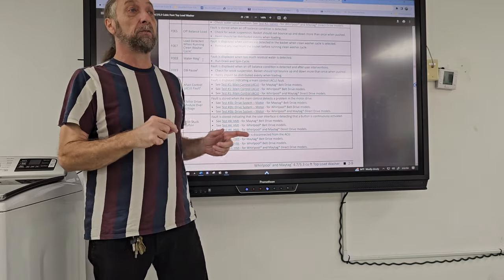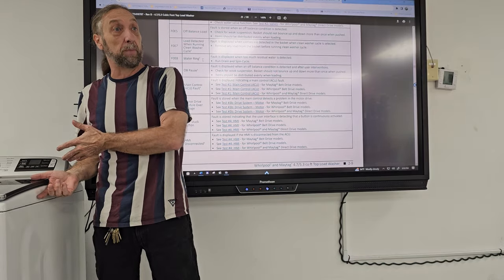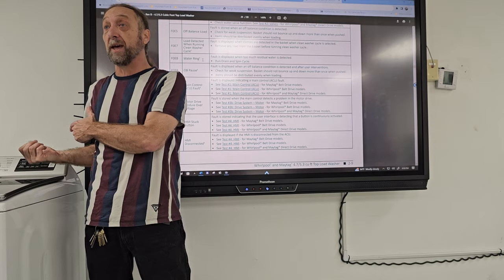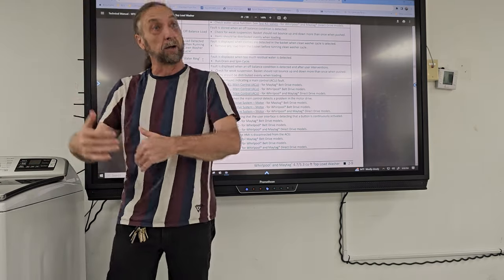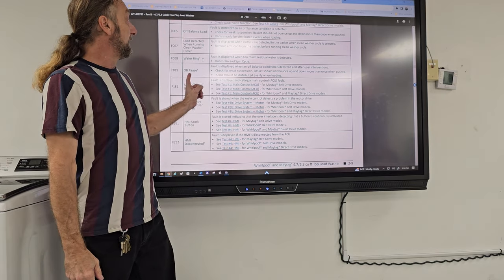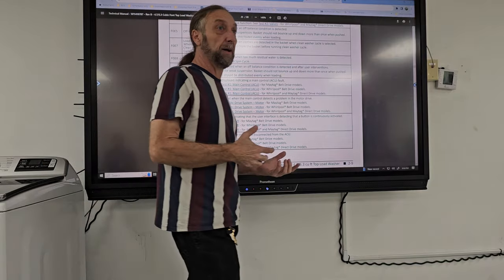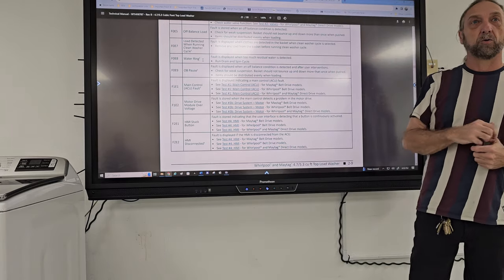Okay. The customer intervention means that you realize that the machine was off balance. You might have heard it banging against the cabinet or saw that the unbalance was registered on the display. So you lift the lid and try to move the clothes around, then close it back and try to resume the cycle. But they're saying here that if the customer tried a couple of times to correct that off balance cycle but didn't fix it, now a fault code will come up.